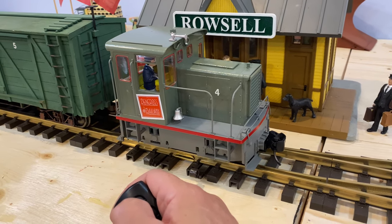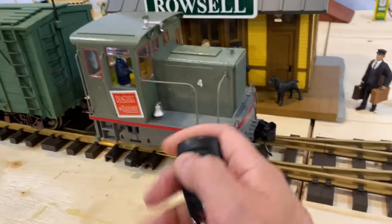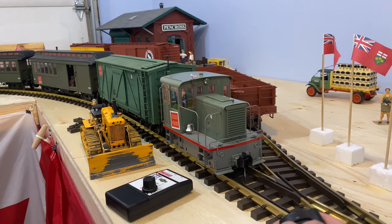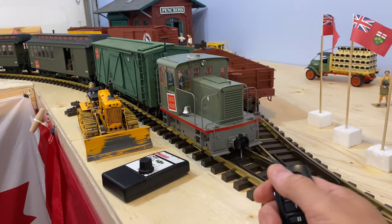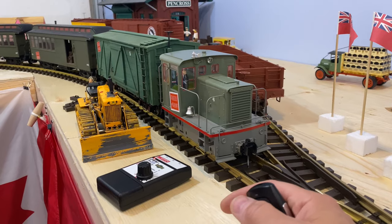Little brake squeal and stuff. And the heavier the load, the more brake squeal. Only thing is, the brake squeal happens when the darn thing's already stopped. If it's inevitable it's going to happen, it's going to be a big, long squeal. When it goes into neutral, toggle back and forth a couple times between neutral and forward or reverse or whatever, and then as the engine revs down, there'll be no brake squeal. I don't feel like I should have to do that.